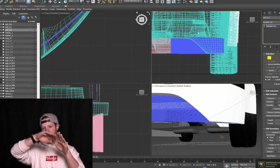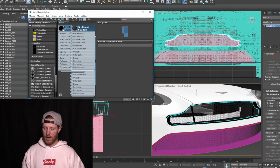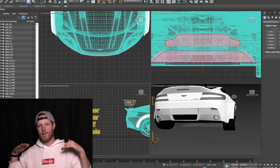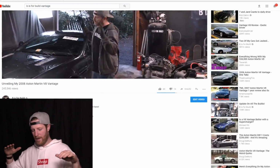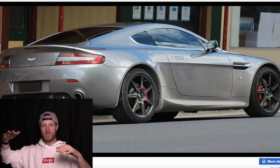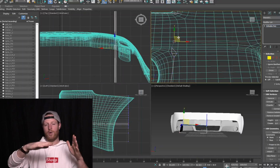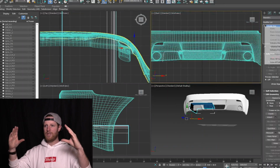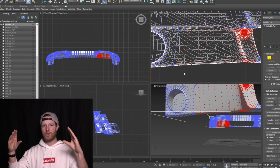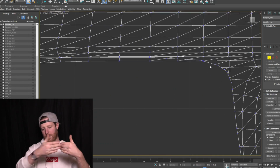From there, we're going to extend metal around there, making kind of like a lip on it that's going to stick out of the car, that you can see here a little bit. And then we're going to have an under tray diffuser that's going to come out from underneath the car. It's going to be a lot more heavy duty than what we built on the Evora, but the same type of style where it's going to bolt into the chassis and then come out and under the car. It's just going to be a lot more heavy duty. And the piece from the bumper will mate up to that. It'll actually physically screw into that diffuser. And again, honeycomb grille in front of that.